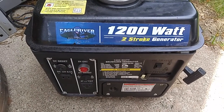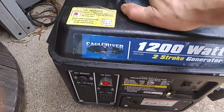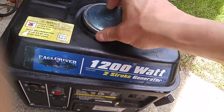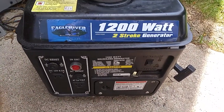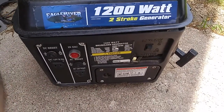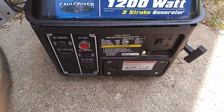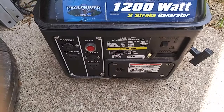Looks like somebody added fuel to it. I can't remember if it had fuel in it, but somebody had it out so I'm guessing it got fuel in it. It looks colored, and I'm not a two-stroke guy — they're just gross to me. But anyways, it looked like I was getting fuel, looked like I was getting air, no problem. The air filter wasn't so bad. I took the cover off, inspected inside, sprayed a little carb cleaner just to avoid having to disassemble the carb — that would be the next thing I'd do if fuel wasn't getting in.